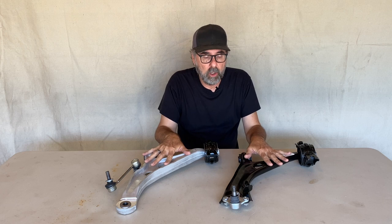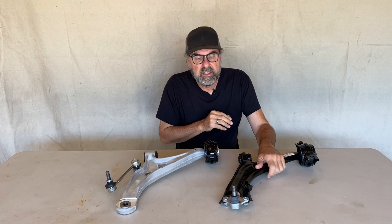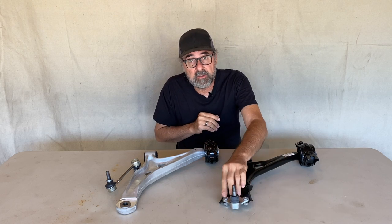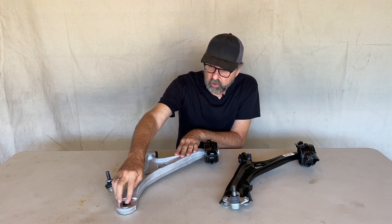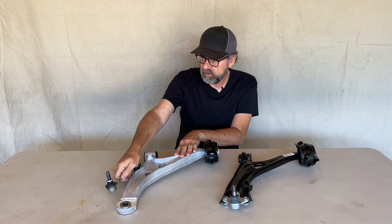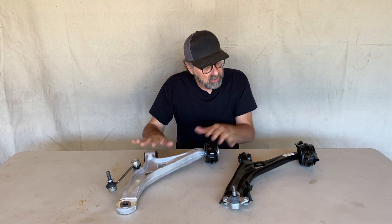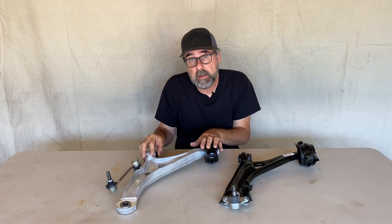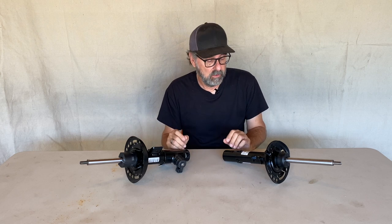Obviously these are the lower control arms — I'm going to start at the bottom and build up from there. This one's steel, it's a stamping, the ball joint is bolted on as a separate piece with three nuts and bolts. This one's aluminum — the ball joint isn't configured the same way, there's a boss here for something to press in from the top, and then there's this little linkage here which we'll figure out in a short while. What they share is a mounting strategy because they bolt onto the same subframe, so the bushings look similar. Here are the struts — regular Civic and Type R — the spring seats look pretty similar but there are many differences.